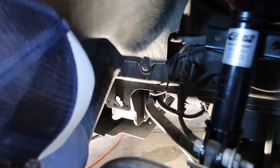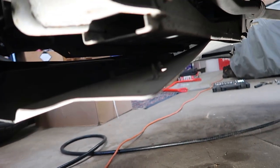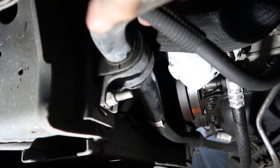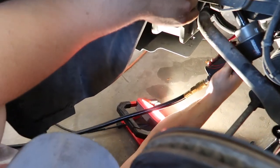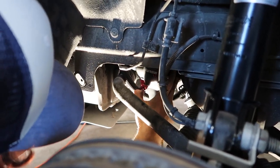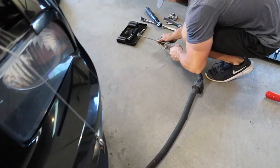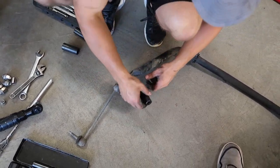Now we're going to do the sway bar upgrade. End links are already out. In the sway bar there are two bolts on each side — take those out and it should just come right out. There's always something — it should, but it never does. We're going to clean that up. It's kind of hard to get in there with back problems, not a lot of room to work. Old sway bar's out. Now we need to transfer some parts over to the new one. These look like they're in good shape — new end links are an easy five-minute fix if you know what you're doing.